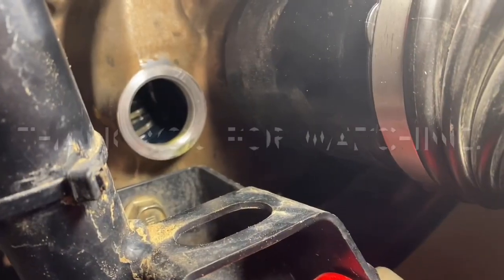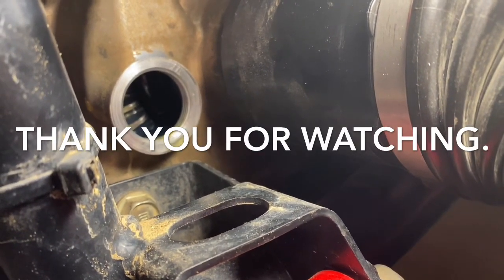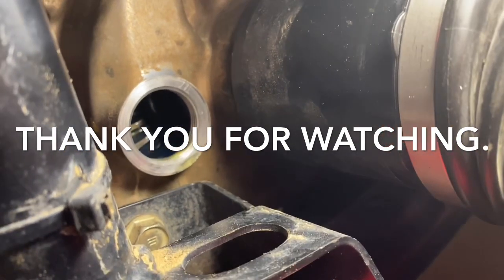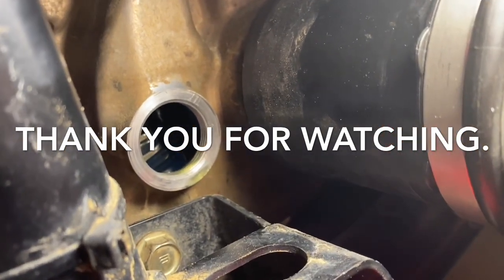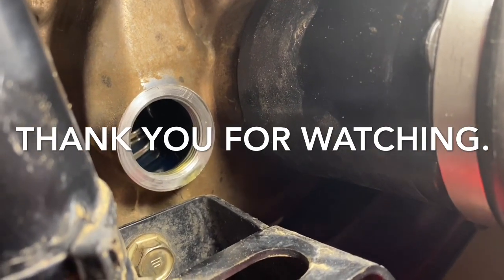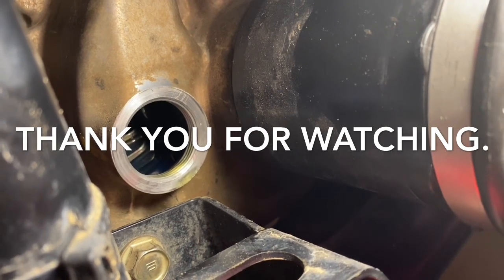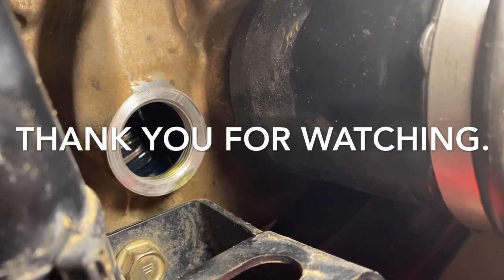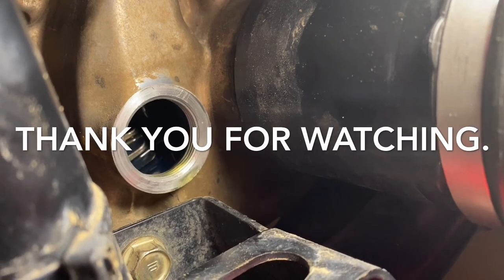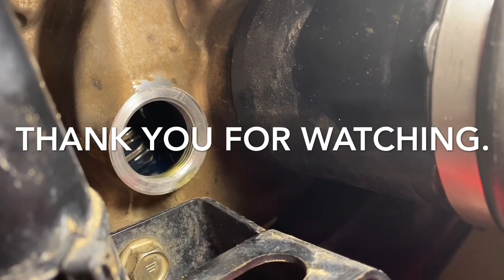All right, we have the front suspension settled back to its natural level and filling up the front differential. So keep in mind this 80/90 flows pretty slow. So I've already filled it up twice and just waited, and it settled back in. So keep that in mind. You might have to fill it up a couple times for that oil to move around, especially at colder temperatures.